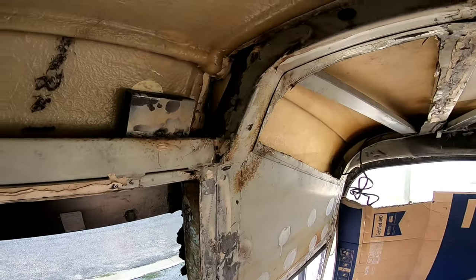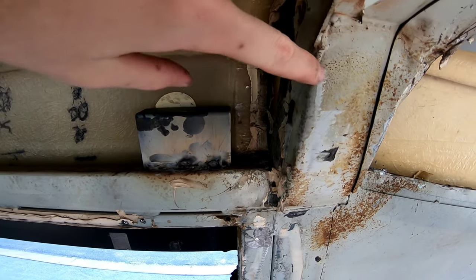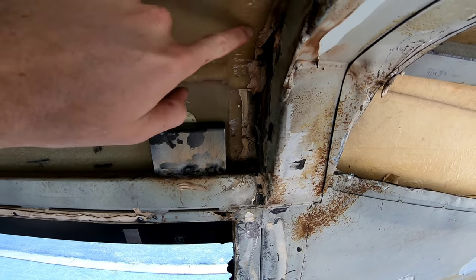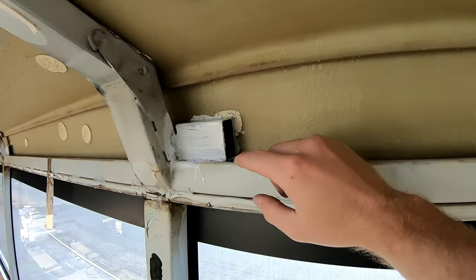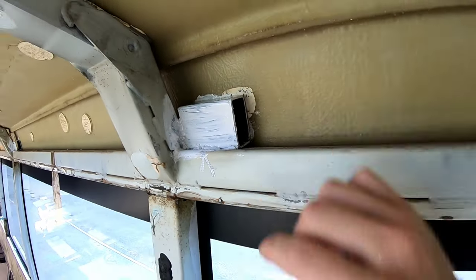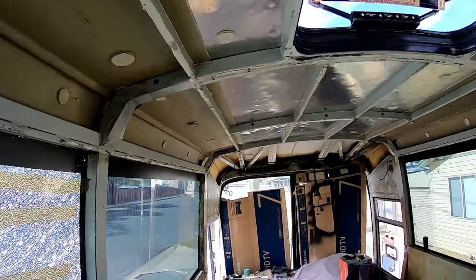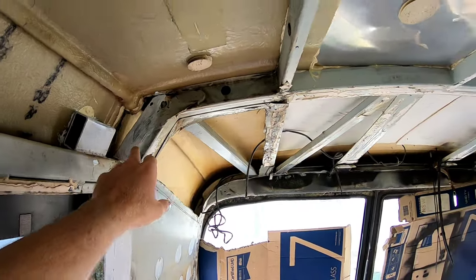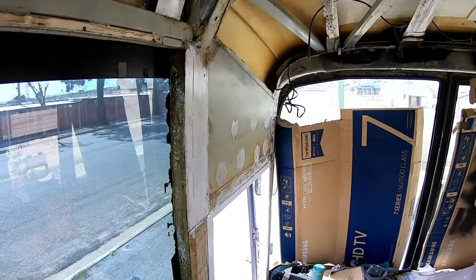This one I had to move out from the pillar a bit because of the fiberglass seal, because that seal is very thick. I also painted our awning mounts — it doesn't have to look pretty, you just need to stop it from rusting. I also put a coat on these because they've been treated with the rust converter, and just a bit down the side there as well.